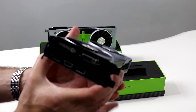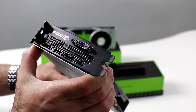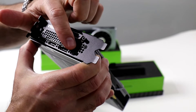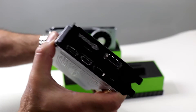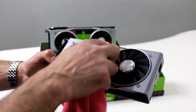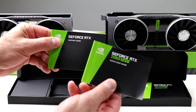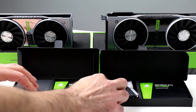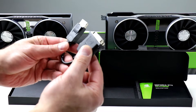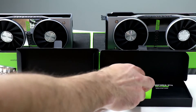It's got the Super logo, and here we are looking at an identical I/O configuration to a traditional RTX 2060: dual DisplayPort ports, HDMI 2.0, dual-link DVI port, and that USB-C Virtual Link port. Inside the box you get various literature items including a quick start guide and support guide. With the RTX 2070 Super only, you get a DisplayPort to dual-link DVI adapter cable, since the card does not have a dual-link DVI connector itself. On the RTX 2060 Super you do get a dual-link DVI connector, so you won't need that cable.